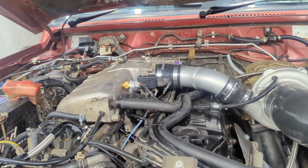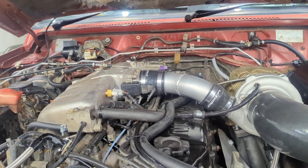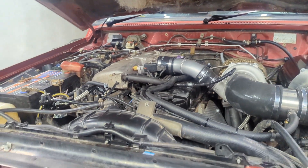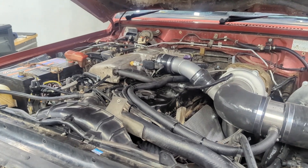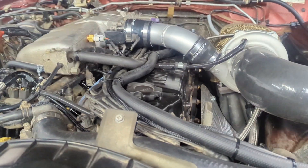And then the direct port ones handle our octane boost. It works a treat — makes really no difference whether you've got a cooler or not. If you don't want to hack the front of your car up, that's a good reason for not running one, but the water-meth system works really well on these sort of builds.